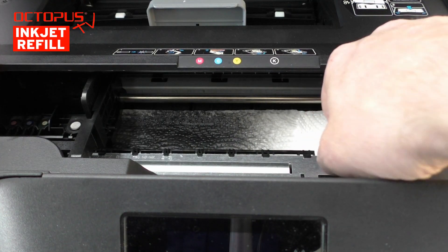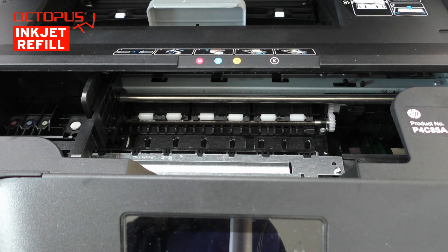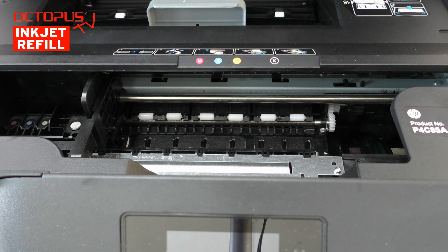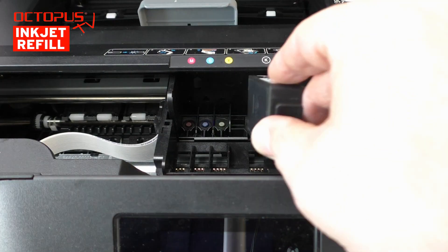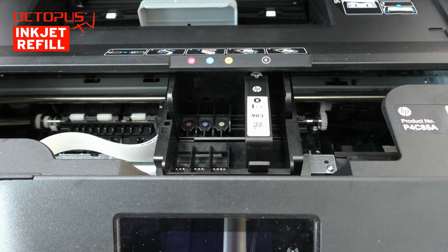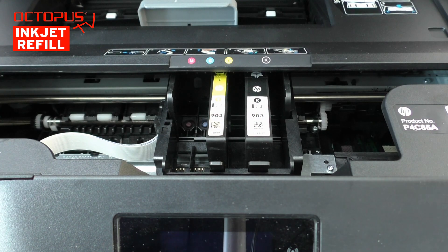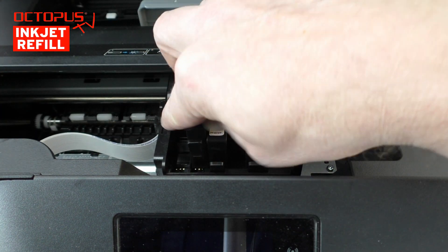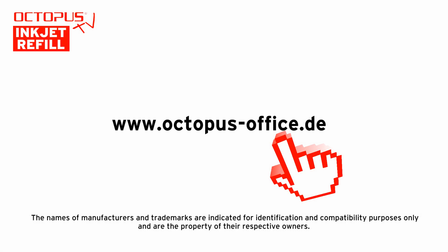Now we take out the protection padding from under the print head, this time including the foil material, and remove both components from the printer's working area. Finally we take our HP903 inkjet cartridges and click them back into their positions inside the print compartment in our HP multifunctional printer. Hereby the manual cleaning process of the nozzles is complete. Our cleaning approach leaves some nozzle cleaner fluid remaining in the ink system — to get the look of your prints back to normal you can print out that cleaner by running some test prints.